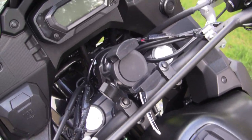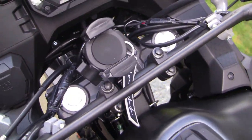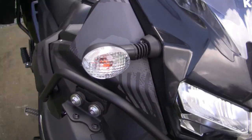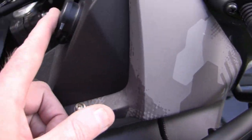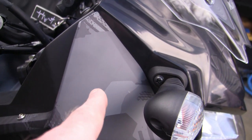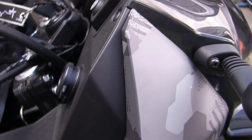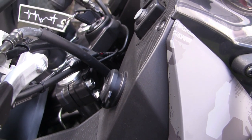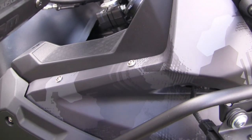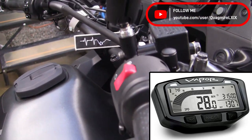I'm going for a ride here. One of the things I've put on is the Zumo XT. I tapped the power wires for the Zumo over here on the accessory. If you go inside, take this panel off and get inside there, you'll see a couple of barrel connectors behind there. I'll put up a little video on that — I took some shots of what I did. I'll show you how I tap the power there, and I'm probably going to tap that same place for power on the Trail Tech.